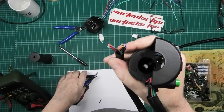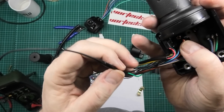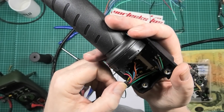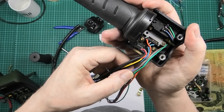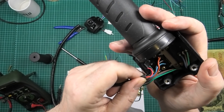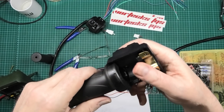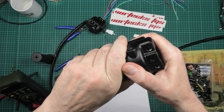I'll take that off and figure out what the wiring is. There's a bit of a bodge job there with insulating tape — we'll have to remedy that. I always take these apart, number one to check everything's seated properly and nothing's going to fall out, and number two because I do my own wiring diagrams. I'll take my own measurements to make sure they work and I'm 100% certain on the wires — website pinouts have been wrong in the past. As for waterproof — no, it's not. Water gets in and I don't think it'll hurt but you can't class it as waterproof.